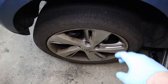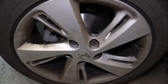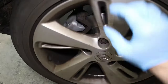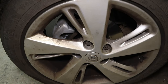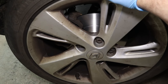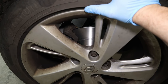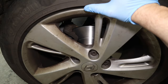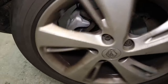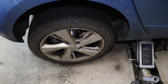All right, just give it a quick test. Wheel spinning free with the brakes off. Brake pedal applied. Rock solid, released. Spinning again. Handbrake on. Yeah, locked up and released. Let go of the foot brake. There we go, perfect. Right, we get her back down on the ground now.